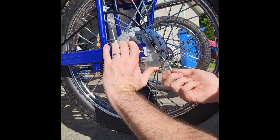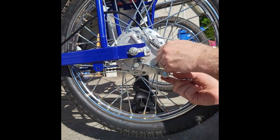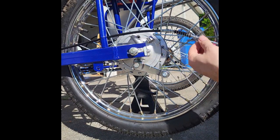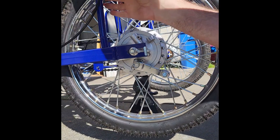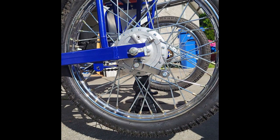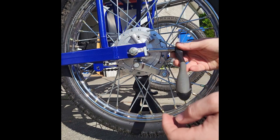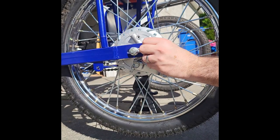To remove the brake cable, we can press and apply the brake to loosen it up, then untwist that little adjustment nut. Simply pull the brake line out — it's seated into the hub and you can pull that out. Put the spring back on the brake cable and the adjustment nut on the end and set it aside. Then loosen up the adjustment bolts for the rear wheel and take those all the way off so the axle can come free of the frame.